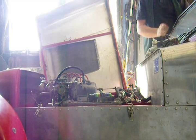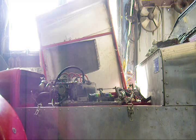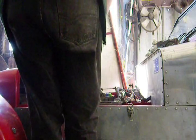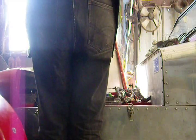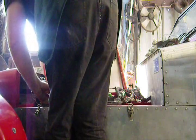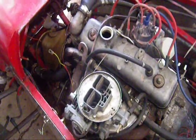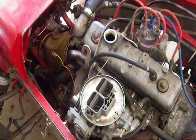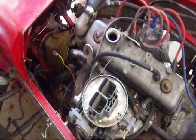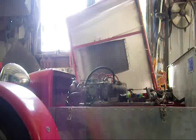Well, that is obviously holding it off. OK, as you can see I got it to fire, but the throttle cable is not right — it won't return to the idle stop. I have to rethink this a bit.